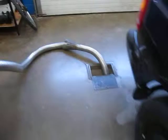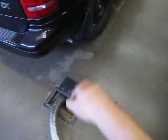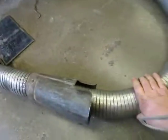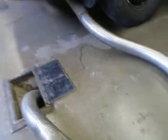All right. Then we have to make sure the exhaust system is hooked up. So we go back to the back. No one's using this vehicle right now, so we're going to use this exhaust hose and put it onto our exhaust of this van. So we're just going to bring this around. We're going to put that on there. We're going to make sure that's on there really good, and then we're going to connect the two hoses here. All right, so they're connected and going a long ways into the ground, the in-ground exhaust system. I'm going to make sure that stays on there, so that is connected.